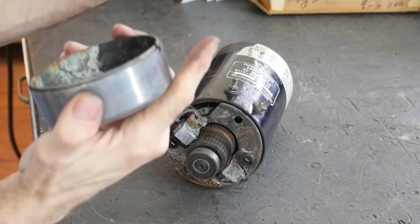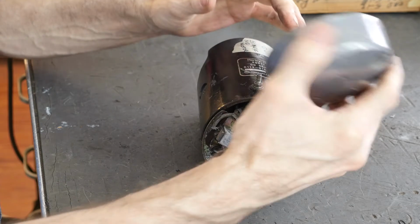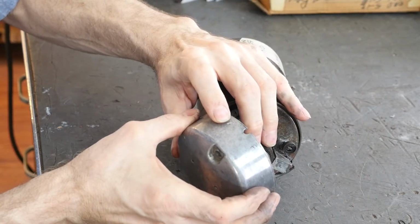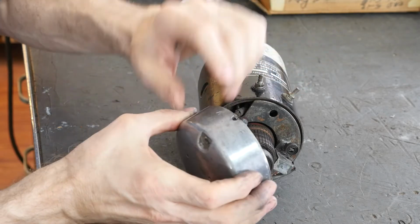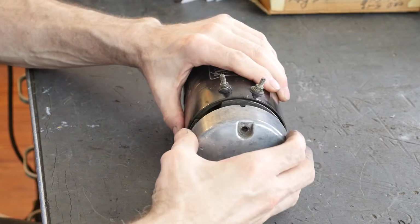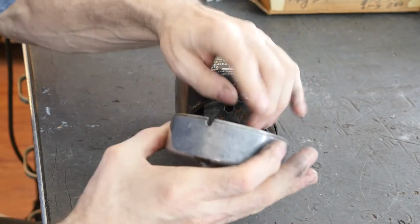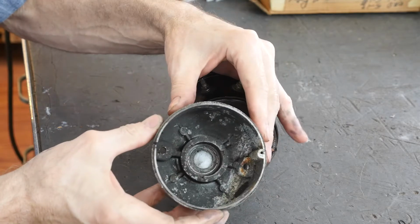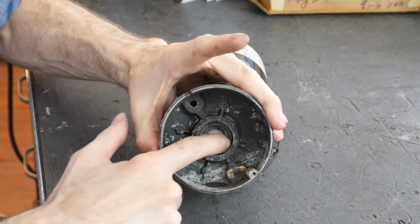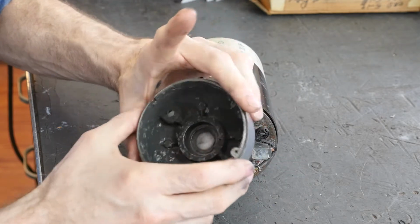Now here's something, I think it's a design flaw. I think Harley didn't communicate how this thing gets bolted into the motorcycle. On this end cap, it's got A for armature for this terminal, F for field, and then a weep hole, a big hole. And it points up. So it lets water come into the thing, and then it's sealed here. So look what's happened to this one.